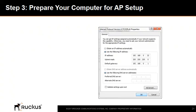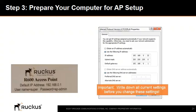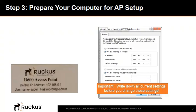Enter the following parameters. Pick an IP address within the same class as the default gateway, which is 192.168.0.1 — shown on the sticker on the back of the access point. It is suggested to use an IP address of 192.168.0.22 or another number other than 1 for the fourth octet. Enter a subnet mask of 255.255.255.0 and the default gateway of 192.168.0.1. As an important reminder, write down all current active settings your computer had before changing them so you can restore your computer to its original configuration after this process.